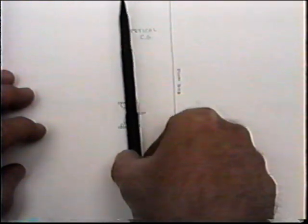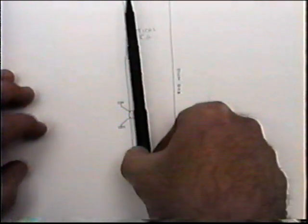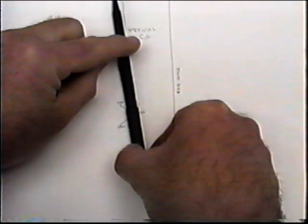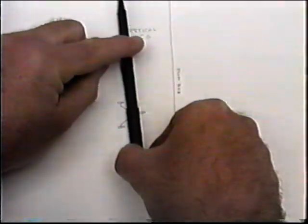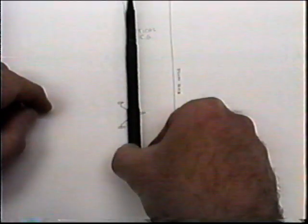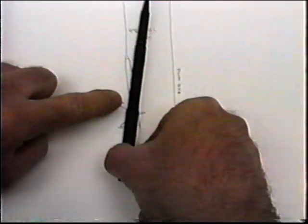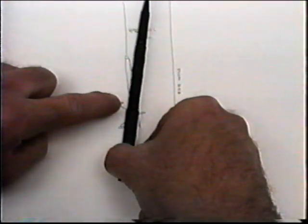And almost every time you do that, you're going to find out the plane is just a little bit yawed out or a little bit yawed in. It's almost never right on the money. And you can fine-tune it this way. If the bottom side, the landing gear side, needs to be a little heavier, you can add a little lead into the wheel pants.